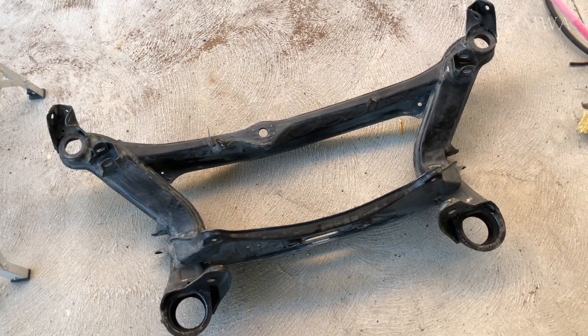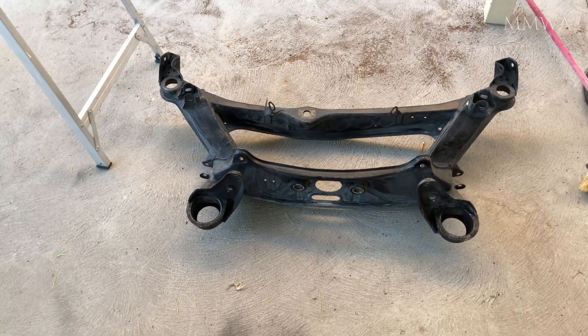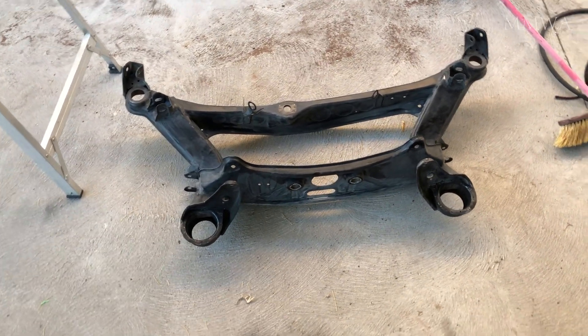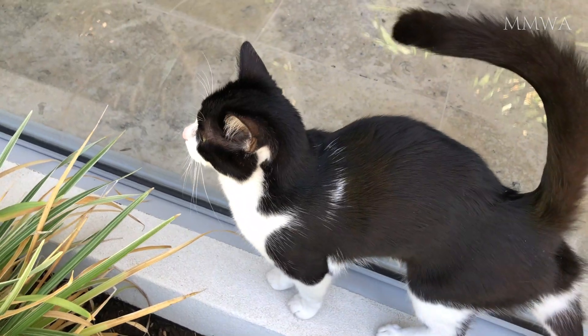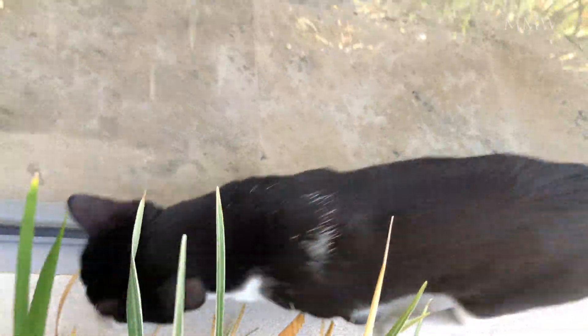While I had the chance I did pull the bushings out of that subframe. My method is probably considered anti-social and against environmental concerns for this day and age. I actually bend up the outside tabs and then basically set the bushings on fire until they drop out of their holes. It produces a lot of smoke and smell but it works — I don't have the tool to get them out otherwise.